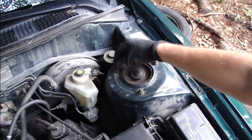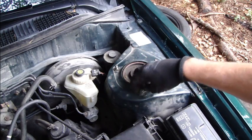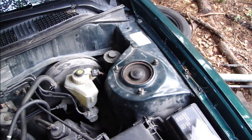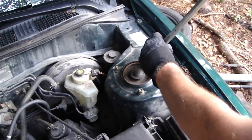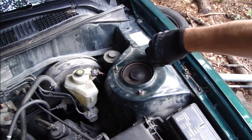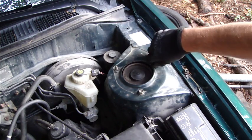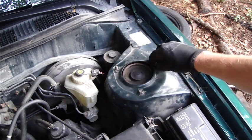Okay, and then I take these bolts out, and please remember to keep 1 bolt left, because otherwise this coil spring strut assembly drops directly down, and it hits our drive shaft seals, and it can destroy our drive shaft. Okay, now this is it moves.